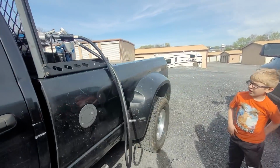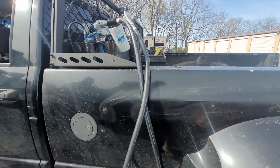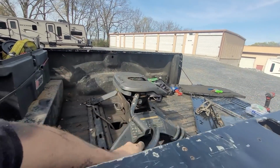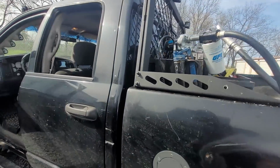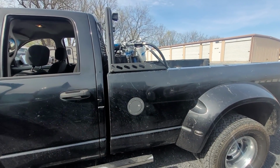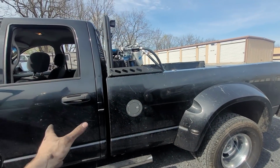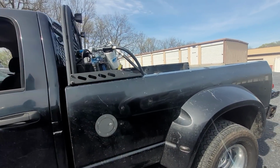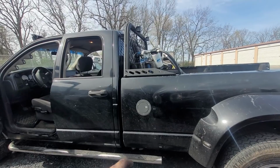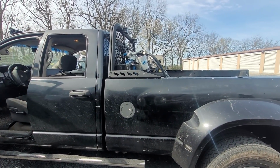Is because we're going back 100% to straight waste oil on this thing. Apparently, waste oil is way cheaper to buy in my area than diesel fuel. And I've been doing a lot of research on why the fuel filters plug. Mainly, if you switch back and forth between diesel and waste oil, it will clog the filters, because diesel puts a little bit of a layer on the inside of the line, so when you run waste oil, it cleans all that stuff off the line, thus clogging the filters. Not only that, but there's a bunch of junk inside of it as well.